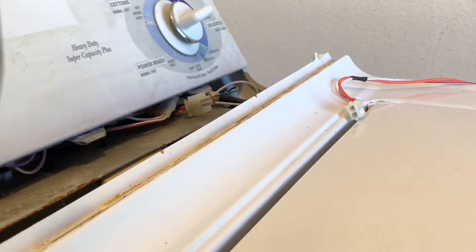Remember to disconnect the washer while you put the jumper — that's for safety. I recommend not leaving this washer running without a lid switch, because this washer spins at higher RPMs. If somebody, like a child, opens the door and puts their hand in during the spin cycle, it can literally break your hand because it's very strong.